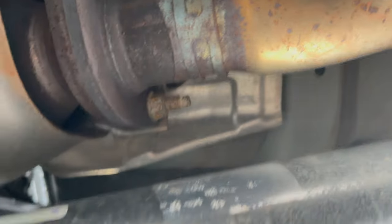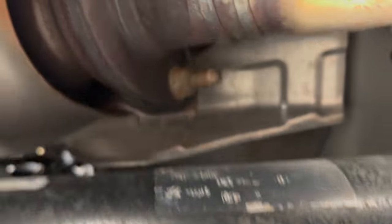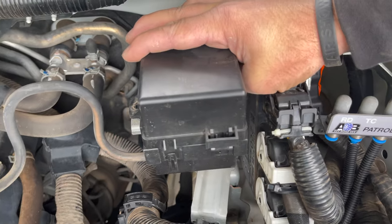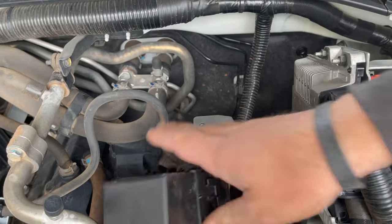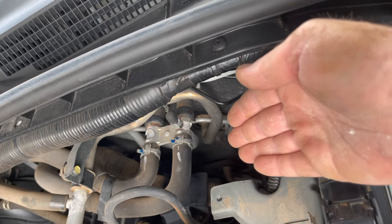That's the front tail shaft there and that's the exhaust header off that side — so it's super, super close and hard to get to. We'll go back up the top and see if we can get to them. This little fuse box next to the ECU on the left-hand side of the car — one 10mm bolt and one little clip — gets pushed out of the way and that gives you a good angle to get your arm right in there.